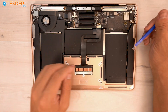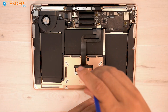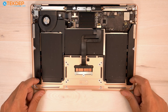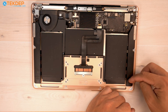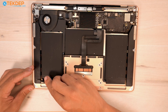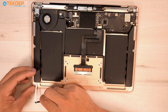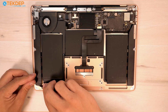Now we have to unplug our speakers on both sides — the right-hand speaker, which is going to be glued to the logic board, and the left-hand speaker, which doesn't have any adhesive. Next, we're going to take some tweezers and remove these pull tabs. These pull tabs run on a glue strip that goes along the speakers and keeps them in the top case. I like to use tweezers because I can grab the top section, kind of roll it up, which helps grab onto the rest of the adhesive strip. Once I get it rolled a few times, I can just pull straight back and it pulls most of the adhesive strip off the speaker.